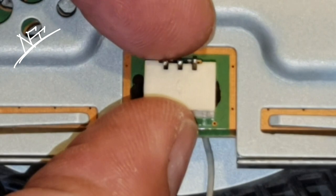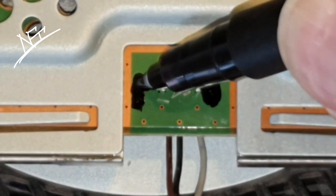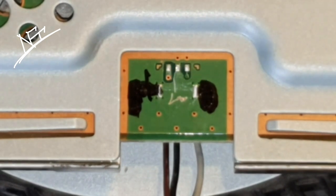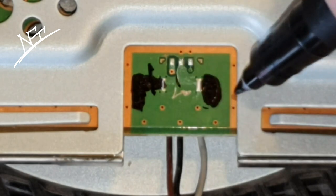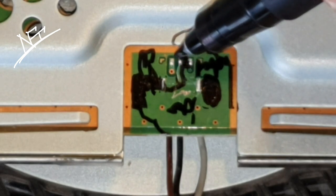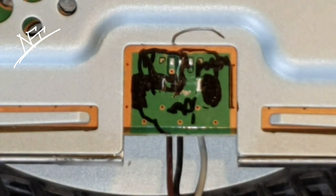You don't need to scratch it just like I have painted. You just can scratch it here on the left side, just around here. Just scratch it on the left side and here on this small side. Then you're going to need to solder just here on this small point. The middle one is just all ground — this is the middle contact. This is a single contact here. The middle one is just all ground and minus. And this one here is again a single one. That's why you need to take care, otherwise you're going to short your PlayStation 4 and then it's game over.